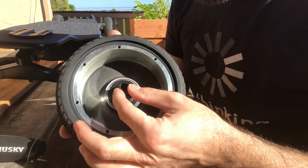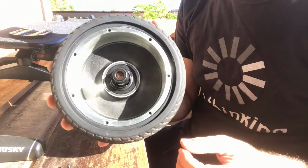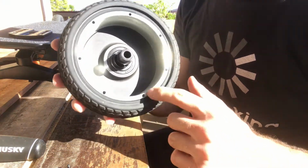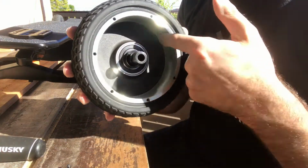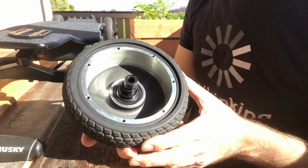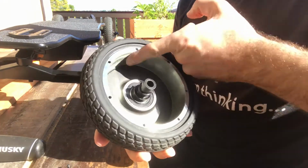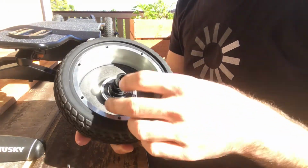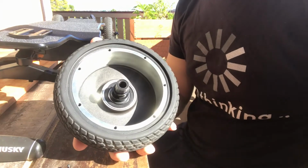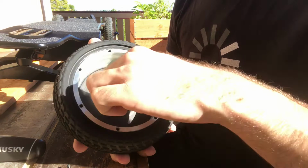And then we have the center shaft, another ball bearing. This looks pretty beefy, and you can also see this is essentially the motor bell. So they use the very same components front and back. Usually you would see the magnets being glued to this as a wheel hub motor, and then the coil set would be inside. So I assume that the rear wheels are actually more like 5 kilos or so.